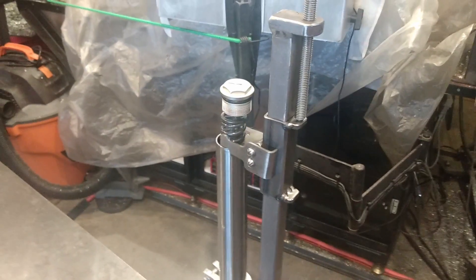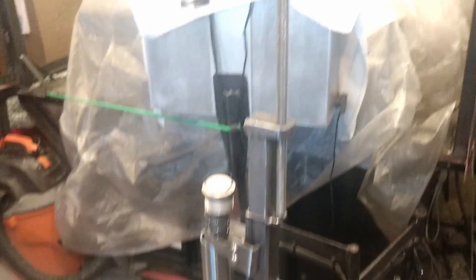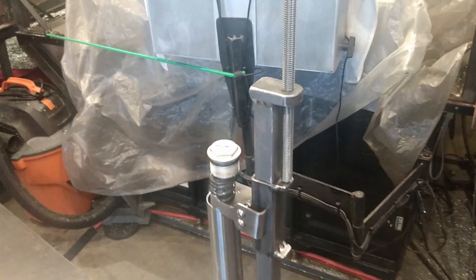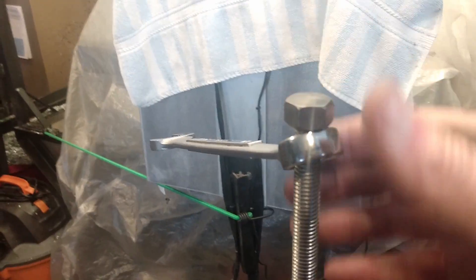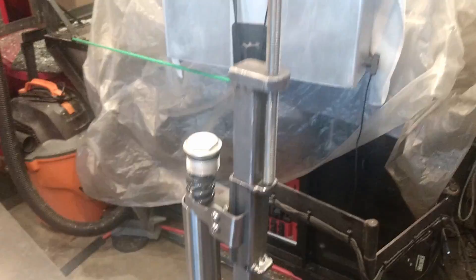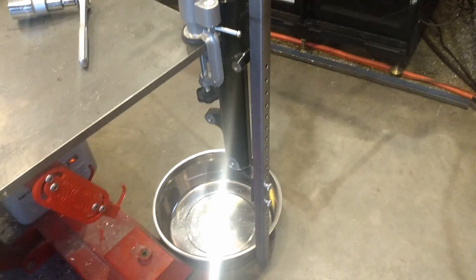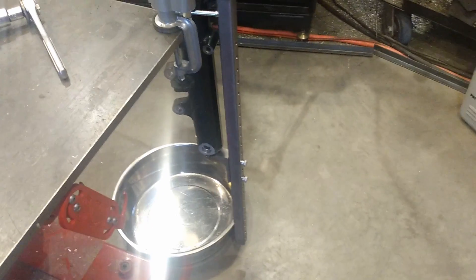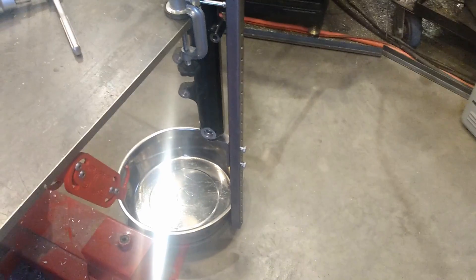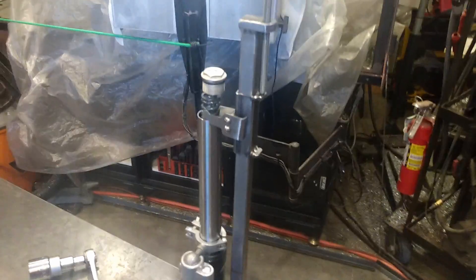So I'm pretty happy with the unit. The only thing I have invested is maybe a dollar in this long 12-inch all-thread, and I welded a nut on the end to turn it into a bolt. It's half inch, so even though all-thread isn't the greatest steel, it'll provide more than enough strength. I hope this helps someone else when they go to build or buy a spring compressor.